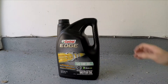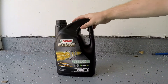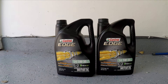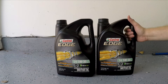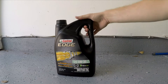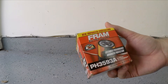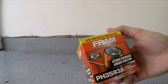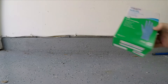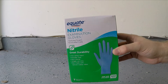What's an oil change without the oil? The 370Z specifically takes 5W30 oil — it's going to be different for other vehicles, so make sure you check your owner's manual. It takes a little over five quarts, so I've gone ahead and gotten two containers. I can use the excess oil from the second container in my other vehicle, because the Sentra apparently takes the same oil. When you're changing your oil, it's also a good idea to replace the oil filter — these are pretty cheap, anywhere from five to ten bucks. It's not strictly necessary, but it's nice to have some nitrile gloves to keep the oil off your fingers when undoing the drain plug.